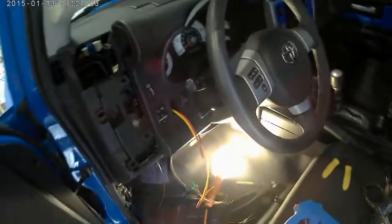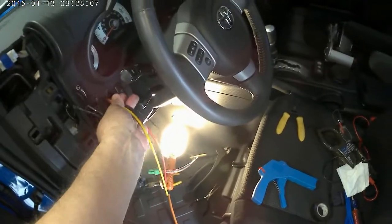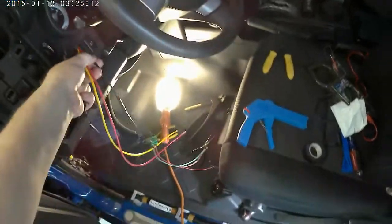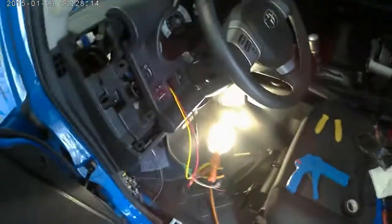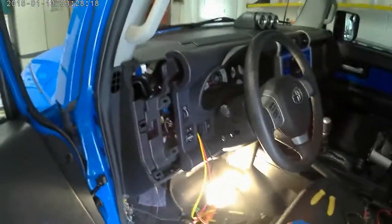And also, guys, when you go ahead and do your switches, allow a little extra. You can always just push it back in there. It's nothing worse than having just enough wire, and then later on, you just don't have enough to do anything else. So remember, don't back yourself into a corner by cutting those wires too short. You can always just shove them right in there.